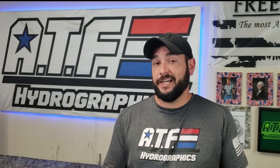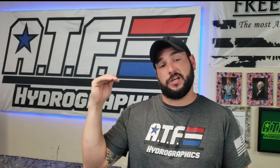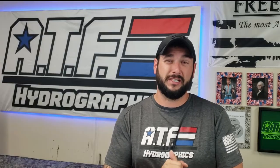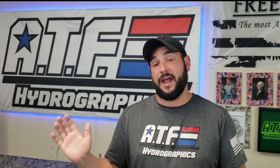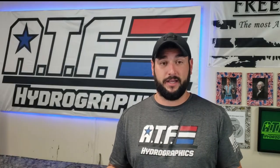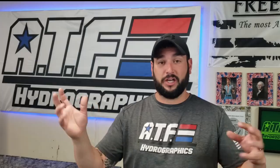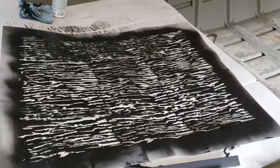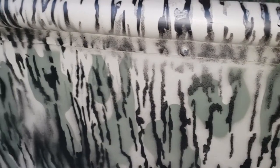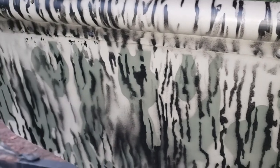So as we continued to paint the boat, the air temperature just kept dropping a little bit and a little bit more and a little bit more until it got to the point where it was like in the low 60s. And as we were spraying, the paint was just turning into like a thick gel. It would not dry at all. So the outside of the stencil got coated in this like jelly paint grossness, and we could not get it off. I tried wiping it with lacquer thinner, and it was even a bigger mess than I really signed up for. So we are scrapping the whole idea of using the Mylar stencils that you hold up on the side of the boat. I've got a whole nother idea.